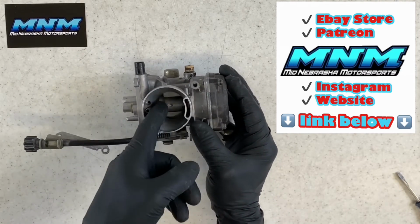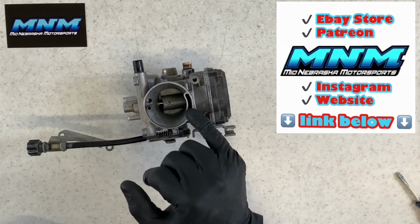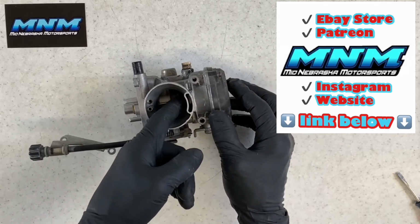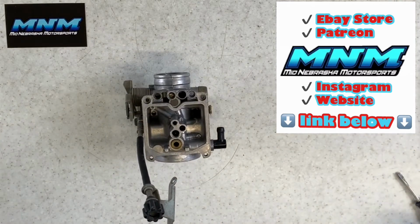You want to make sure that that slides up and down properly. Another test you can do is take compressed air, blow it in this orifice here. That'll actually trick your diaphragm into thinking that air is flowing through there. It'll pull your slide and your needle up. That's just a quick test to see if your slide is working properly.